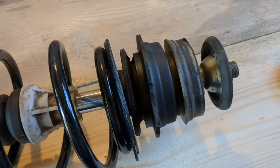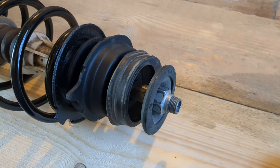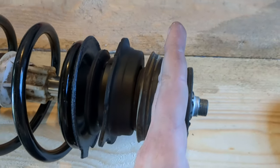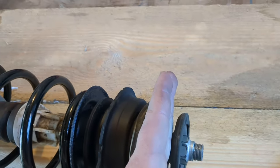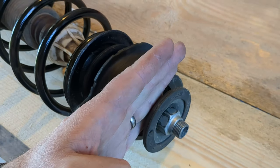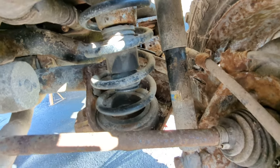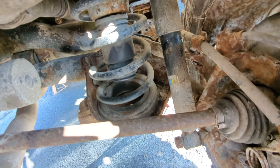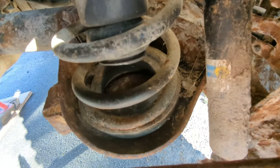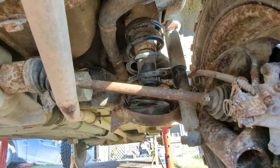The full assembly looks like this with the spacer installed. My hand shows where the shell of the car goes — everything below is underneath the car in the wheel arch, everything above is accessible from the top of the struts. For the rear it's standard Bilstein B4 shock absorbers with standard Panda 4x4 springs. The only thing adding height is the spacer visible here at the bottom of the spring. It's a 20mm spacer and with the tyres it means this car sits approximately 2 inches higher than a standard car.